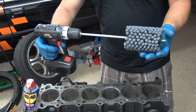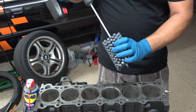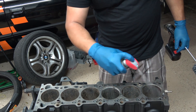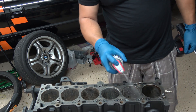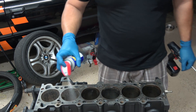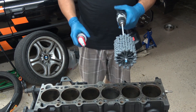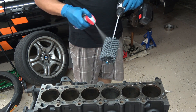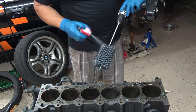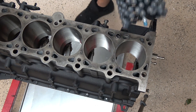You basically attach the honing tool to the drill like this, and then it works like this — put it in the cylinder and move it up and down. I'll show you guys the right technique. First, you want to use some WD-40 and spray down the cylinder, doing all of them so they're all nice and wet. Then I'm also going to apply some to the tool. I'll show you guys how to use a honing tool on cylinder number two.